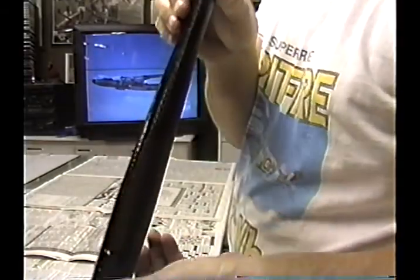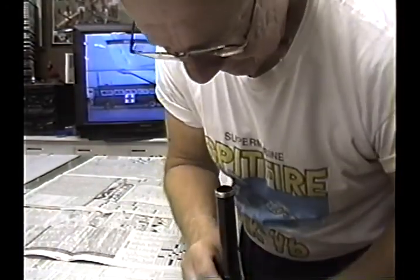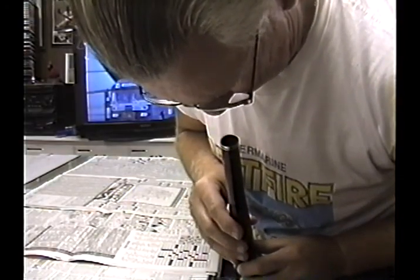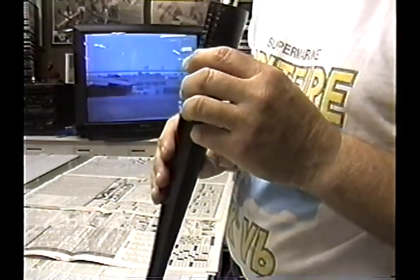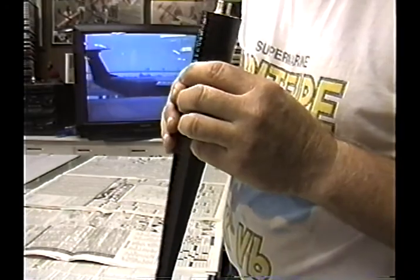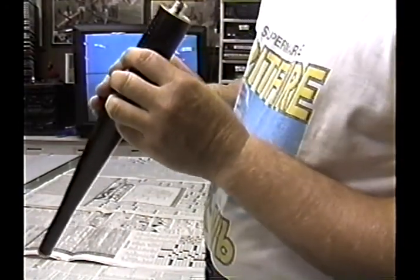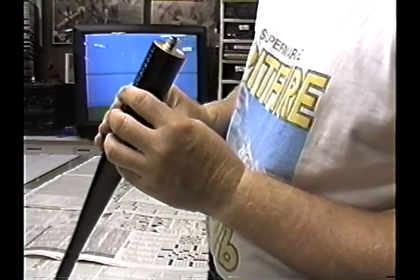Now, what I did, I tried to look inside. I'm trying to look in there and see. It's the first baffle. It's totally loose. Now, it's really difficult when a pipe is made to bond anything aluminum to anything composite. This is just one example of what can happen. Let's see where that piece is. If we can see it, we may have a chance of working it loose.